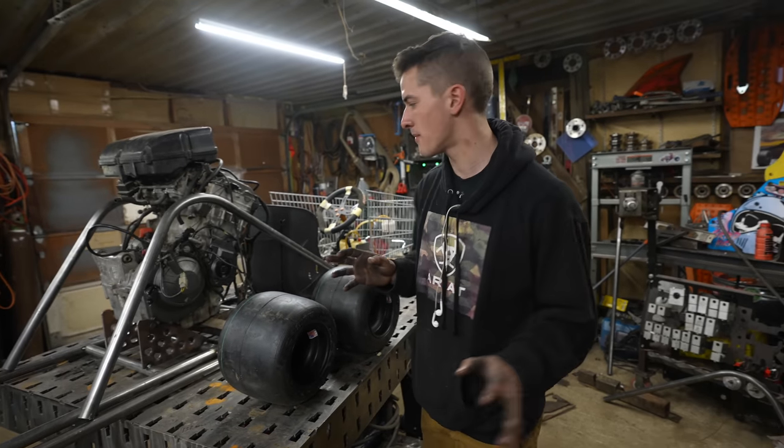Tonight is a super exciting night because we've got hubs and sprockets and I'm going to be working on the components that make this whole thing go. We've got a lot going on right now — I built the gussets for the engine mounts and this stuff looks strong, I don't think it's going anywhere. Now we're moving on to making the seat brackets — I'm going to take a bar and go from this rail to this rail and then screw straight down into them.